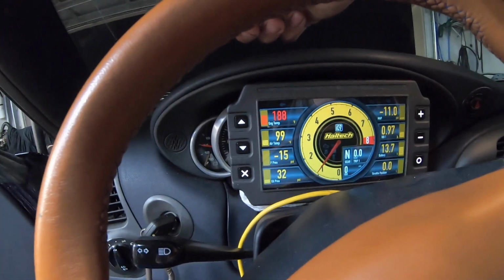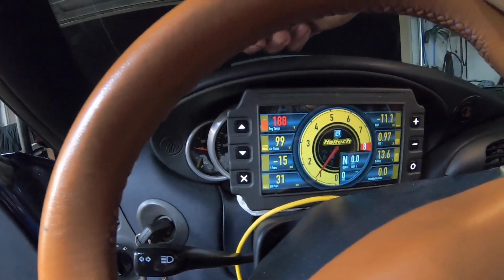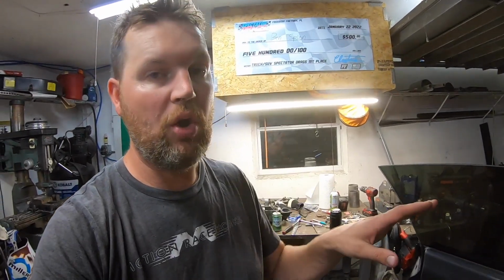All right, guys, no thermostat in the car. Idling. Almost at 190 degrees. Well, guys, I'm not in full spaz mode yet, and I think we're actually doing really okay. We're at about 197 degrees with no fans running. That's with no thermostat, just idling, 197 degrees.